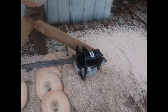If you buy one of these Hyway big bores, and there are saws on eBay, the Hudsel saws with them already installed, take note that it does need a lot of work. Or, you know, the cylinder does. I don't know how it would fare as far as numbers on an OEM set of cases, but if you've got a stock 066 or OEM 660 and you think you're going to buy that Hyway big bore and it'll run better, it may end up running worse.